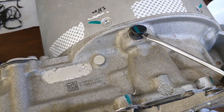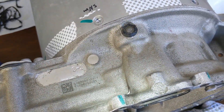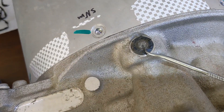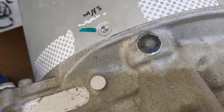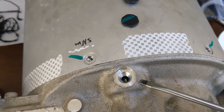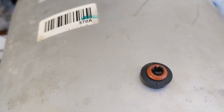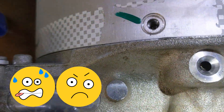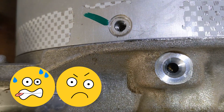There's also a little breather over here — I think this is for the coolant. You can carefully pop up the plastic cap, and what you see looks like it's just part of the aluminum cast, but actually it's some kind of soft, permeable, spongy material so gases can go through there. However, when I tried this, the three snap-fit plastic tabs broke off — you can actually still see one inside. That's a problem — we do not want that in our coolant system.